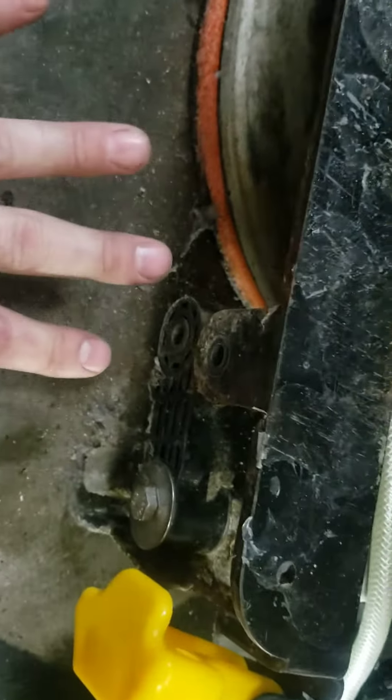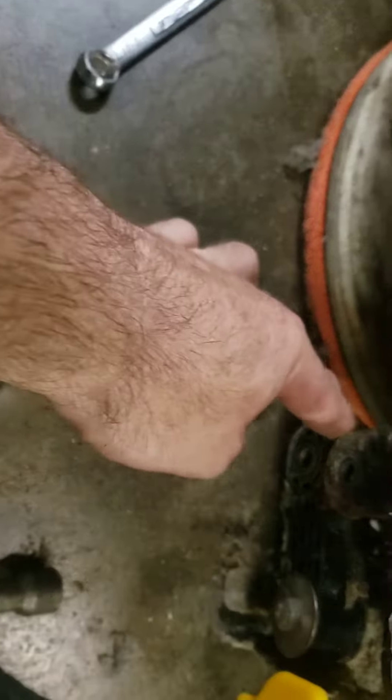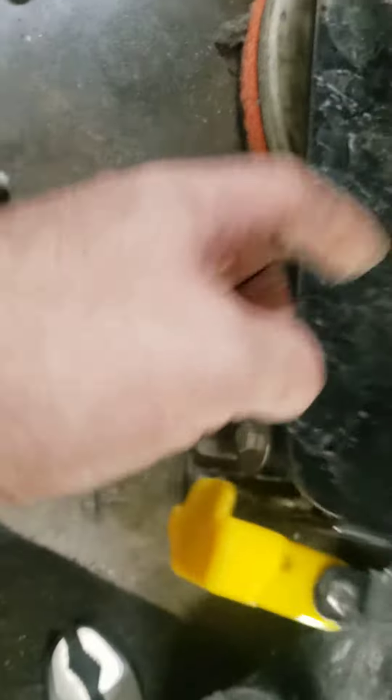Mine's stuck solid. This should just free float up and down as the head glides across the floor. This has to go up and down also. It needs to be cleaned every time you use it. Pretty much just swing this out, spray a bunch of water in there, and make sure that thing's moving freely — both sides.